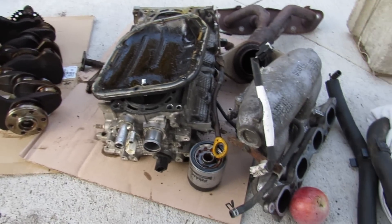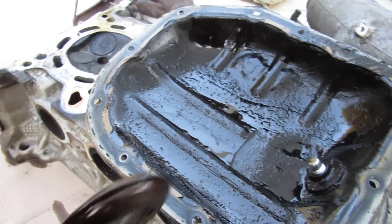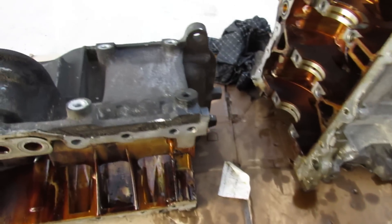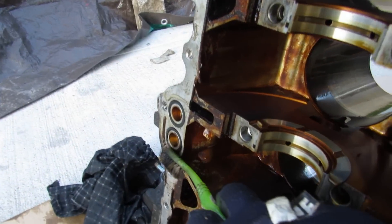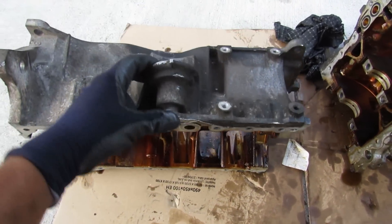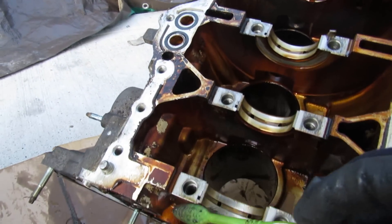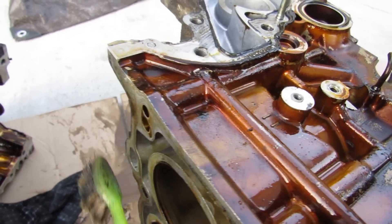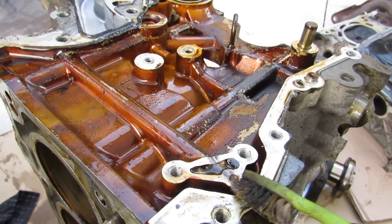With the engine completely disassembled, here's a quick summary of oil flow: oil sits in the bottom pan — sadly full of sludge — gets picked up through the oil pickup tube, also sadly sludged, then flows through the port to the crankshaft-driven oil pump, which sends oil out through the block to be filtered and returned. The rest of the lower pan section just serves as a cover for the upper oil pan with no structural or lubrication purpose. Oil then feeds the main oil galley running along the engine block, with branches to lubricate the main bearings and crankshaft. At the front of the engine a separate port feeds the variable valve timing system, the head lubrication, and the hydraulic chain tensioner.